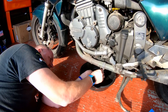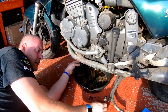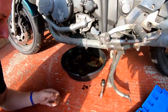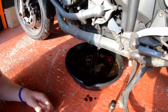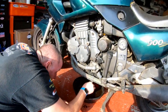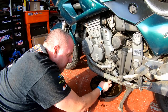Here it comes. Looking at it, I would say there's quite a bit of fuel in that oil — it looks quite thin. There looks to be a fair amount of fuel in that oil. I may need to service those carburetors.